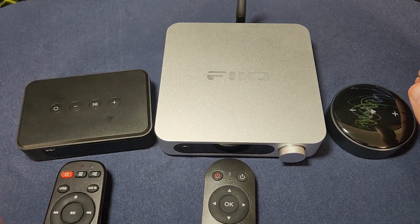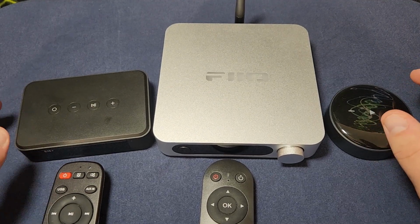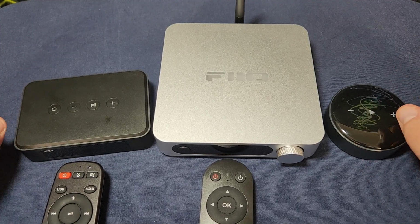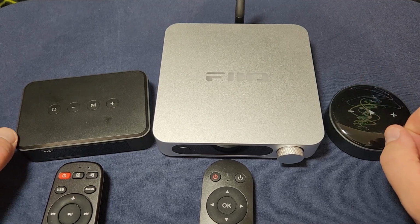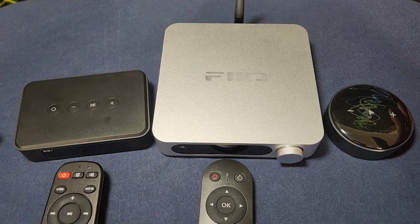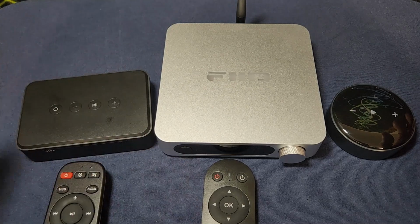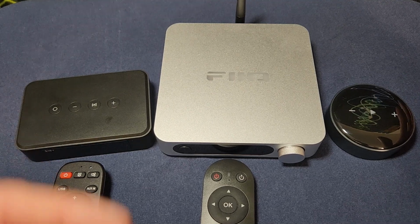Those devices can be very noisy. They have a lot of different electrical circuits going every which way inside of them, and so there can be a lot of electromagnetic interference that builds up inside the box, and that can bleed out into your audio devices if they are connected via USB. Connecting via Toslink optical will help with that noise as well, but optical, particularly from a computer motherboard, is typically limited in bandwidth, so you can't do high-res files, files beyond 192 kilohertz PCM, or DSD, or MQA if that still applies to you. Usually you can't do those from a direct Toslink connection from a computer motherboard. You've got to go USB, but then that brings back in the noise.